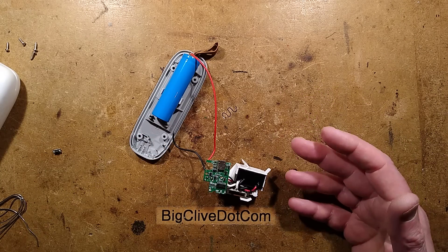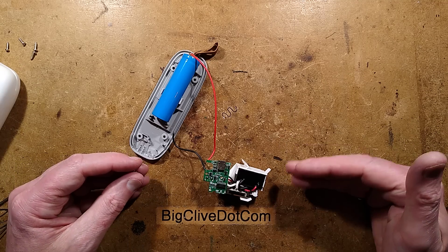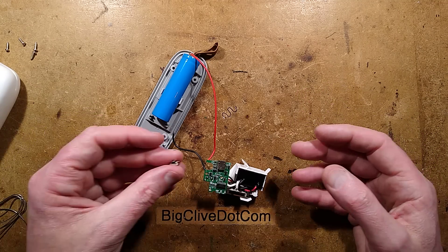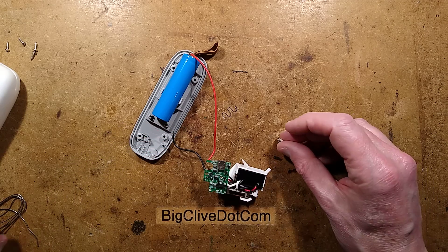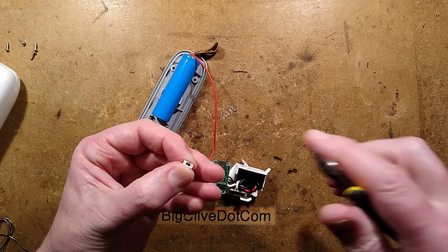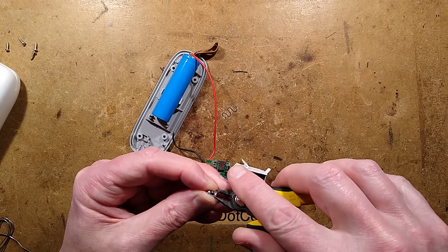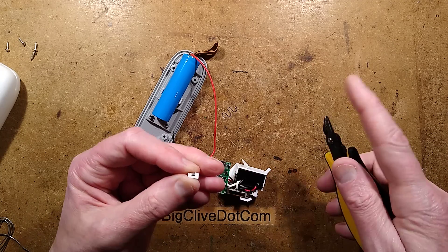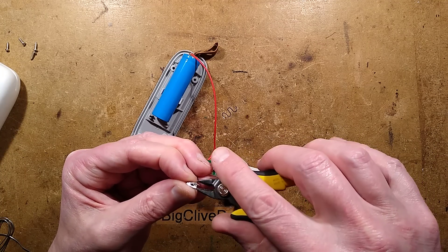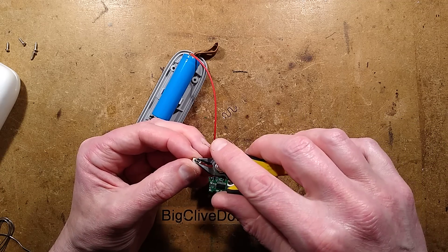This is the third tactile switch I've had short out, including the one controlling the start and pause on my washing machine — it kept going into pause and start repeatedly. I took the panel off, removed the switch from the circuit board, and replaced it with a new tactile switch. I initially thought moisture got into it but it was dry. Replacing the tactile switch solved the problem.